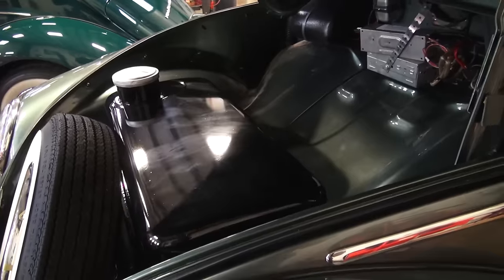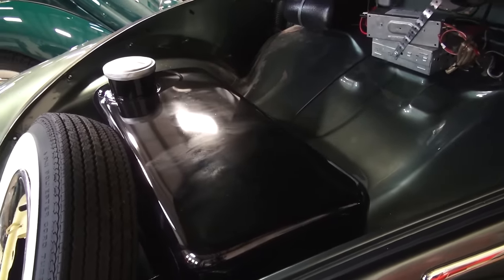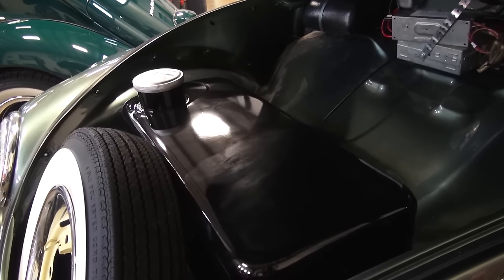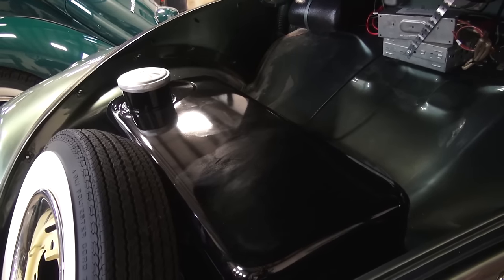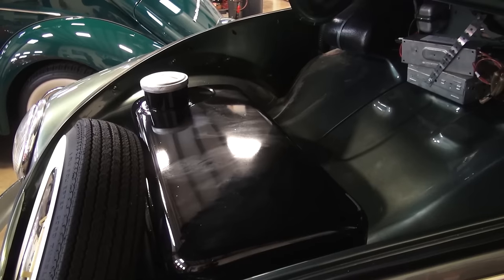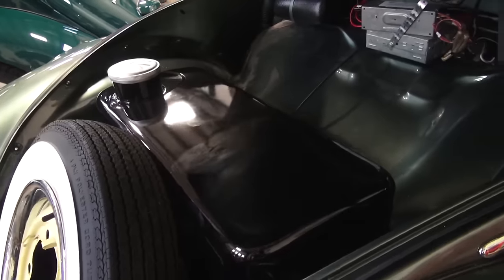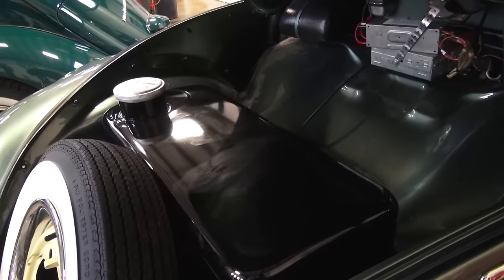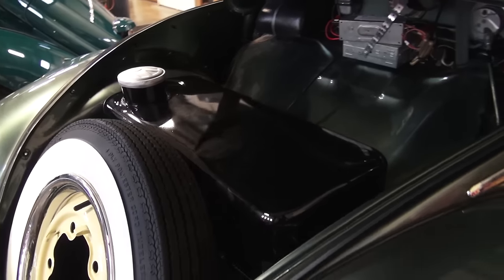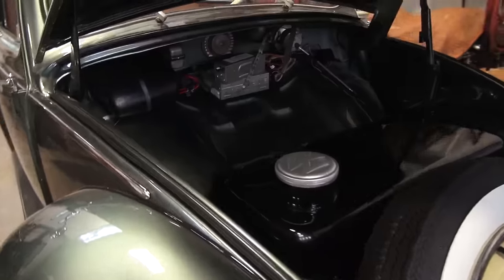And as you can see, our gas tank, we actually send these out now to get acid dipped on the inside. So all the paint on the inside, or any sludge or any rust that's going on the inside, gets completely cleared out, and completely seals the tank. And then the exterior we are now powder coating in a gloss black. I used to sand these down and paint them the old fashioned way. But now as business has been booming, I've got to start outsourcing some things to get some of the items done.